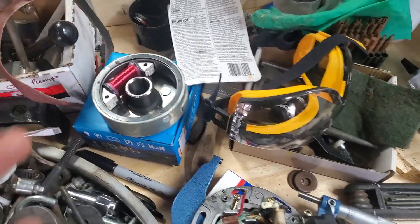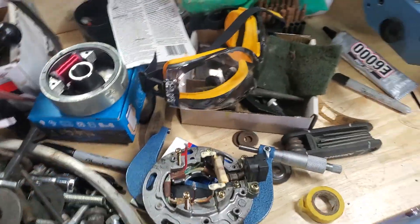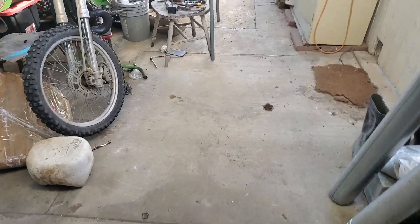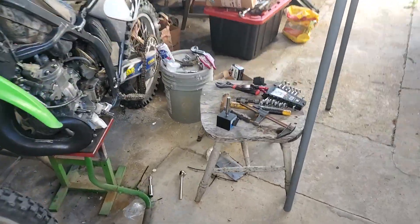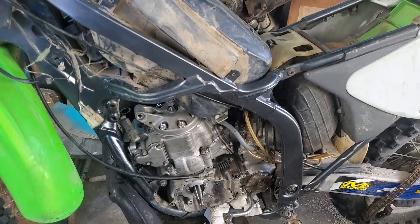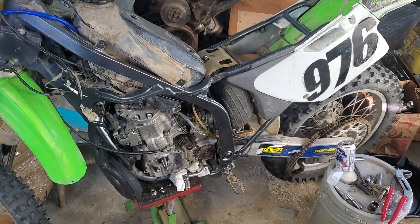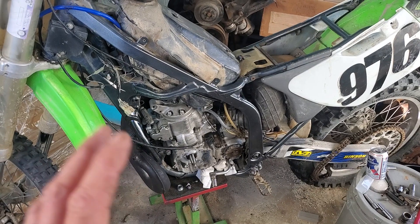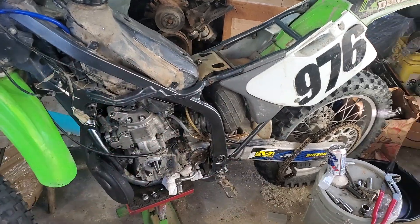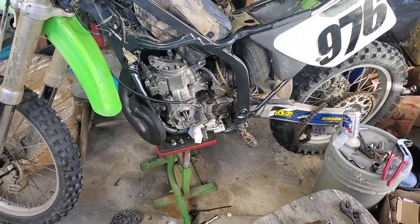I'm not sure what changed in the bike — I have no idea what happened. Hopefully this will get the bike running, because I am very keen to have it run longer than 10 seconds this time. If she runs, we'll film it when I get everything together and see if she stays running. I also have to do the break-in, which I think is a 10-minute warm-up and cool-down — you just let it idle to temp and do a couple of cycles like that before you actually ride it on a new ring and piston. Thanks for watching, guys, and I hope this helps.